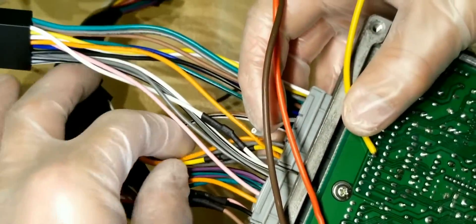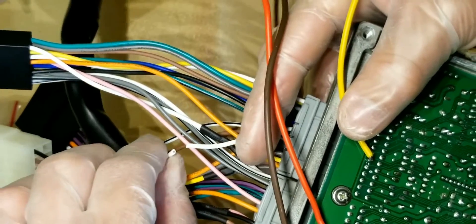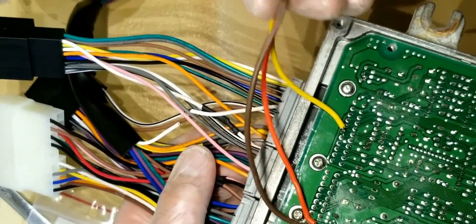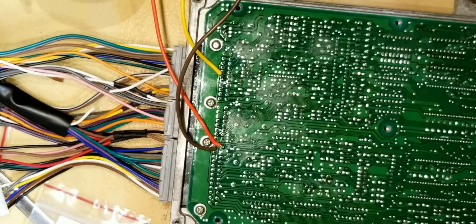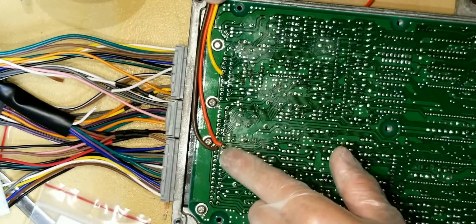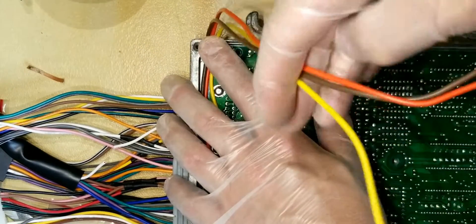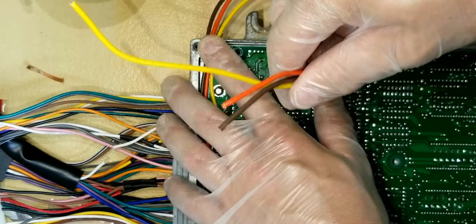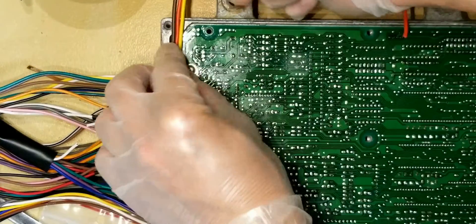I cut this on the harness side as well, and I'm going to put a little jumper wire in there to be able to hook it and unhook it for stock O2, or to run the wideband off the ECU. I think it's better — to me it's cleaner. It takes a little extra time but it works. I'll run everything outside the case; it's glued in, it'll have a new coating on it, everything will be protected. That'll come out the side, and these will be your O2 leads for your wideband. Put spade clips on the end so you can unplug and plug this ECU, and it'll always have a wideband output on the ECU.